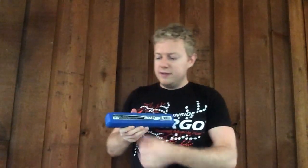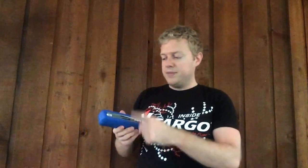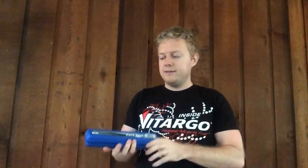What I've got with me today is the Park Tool TW-5, and it's an excellent choice for any bicycle mechanic. It has a torque range between 3 and 15 newton meters, which is ideal for about 98% of the bolts that you're going to encounter on a bike. It comes in a very nice little carrying case.